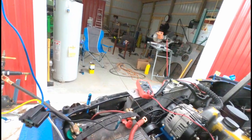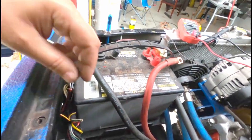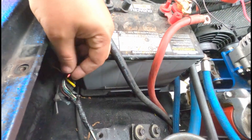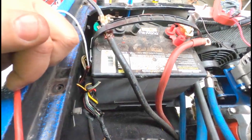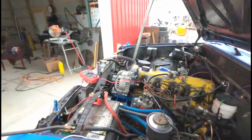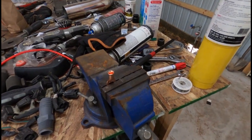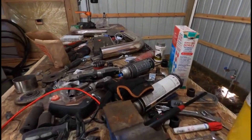The blue wire was the hot to the battery, which I'm not going to reuse, and this white wire is the trigger off the fuse tap, which I'm also not going to use. I spent a little time with my multimeter and found that one wire in the factory harness is constantly hot and this little red wire is a switched 12-volt wire, so I'm going to use that for the trigger wire to the new relay. I mounted a new relay right here and I'll feed constant hot off the battery side and switched off the other side. When you get into bigger wires like this 10-gauge wire, you get into connectors that look like this.